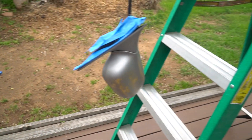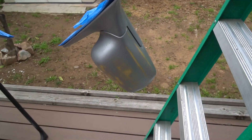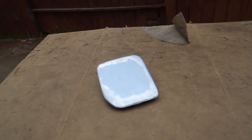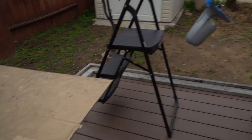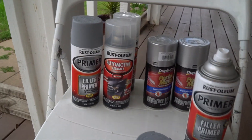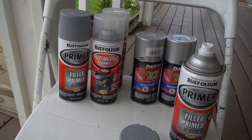I've got two mirrors already sanded down and cleaned them up with acetone to get off any sanding residue and grease. These three pieces are ready to get painted. I found that the Dupli-color Perfect Match rattle cans seem to match the silver pretty well, so I'm going to use that along with some Rust-oleum primer and Rust-oleum clear coat. I'm going to hit these with primer first, let them dry, then paint them up.